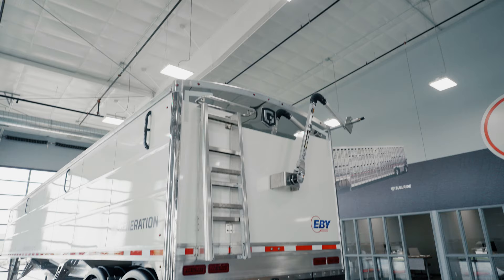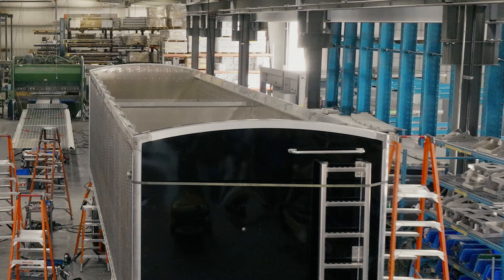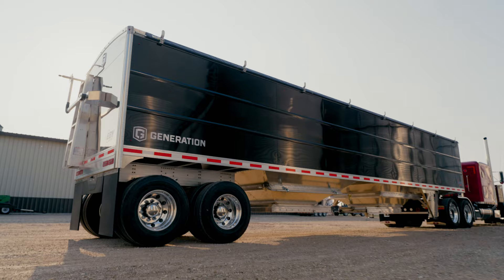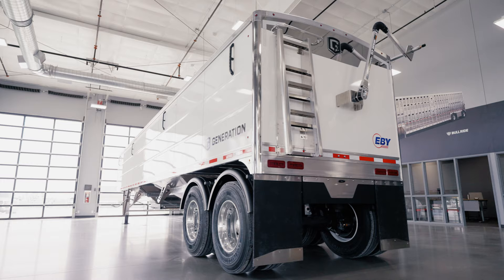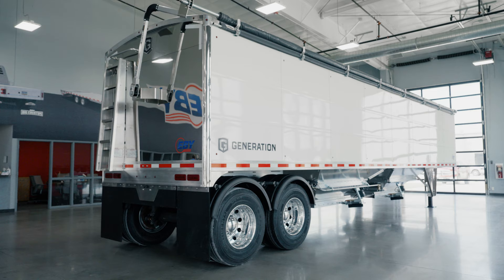The header is arched and integrated right into the trailer — we don't use a bolt-on tarp cap. On the inside of the trailer, we actually enclose that area and vent it to keep all the debris out of the hard-to-clean places. For the 2024 models, we've changed the way we're putting the sheet on the front end and the back end, and we've eliminated the vertical seam down the middle and moved it to a horizontal seam up top. You can go with the painted material at the bottom, stainless at the top, all painted, or all stainless.